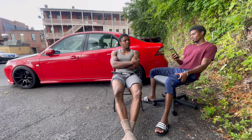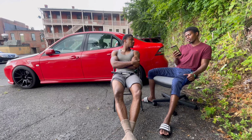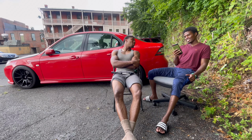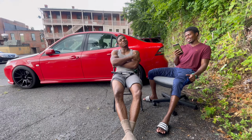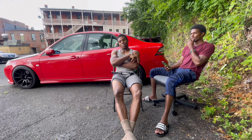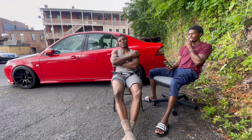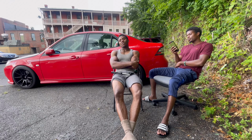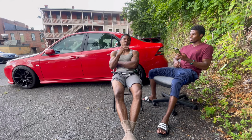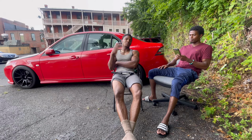Oh, someone said, "Have I missed a video of a full power run with the new turbo?" We did a full pull today, the same day we fixed the oil return line. They must have missed it. If you go back to that video, you did miss it. The car is fully dialed in now, and by the way, it's currently making 23 pounds of boost, but with the new turbo, it pulls a lot harder up top than it did. The other night it made 26. Even at the same boost level as the smaller turbo, this turbo still feels a lot harder, pulls harder up top because it's just bigger. It's gonna move more air than a smaller turbo.